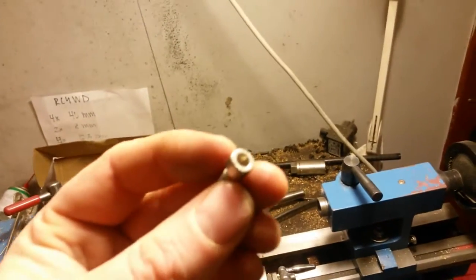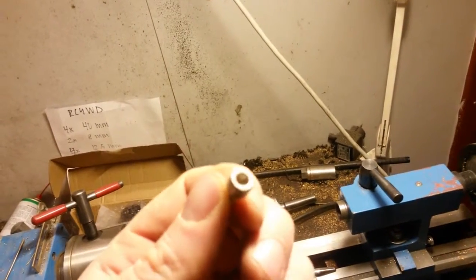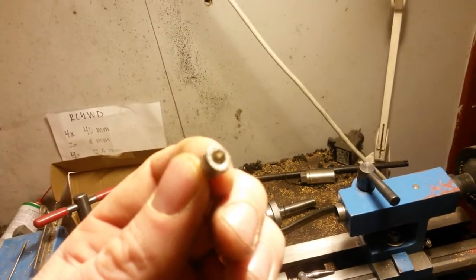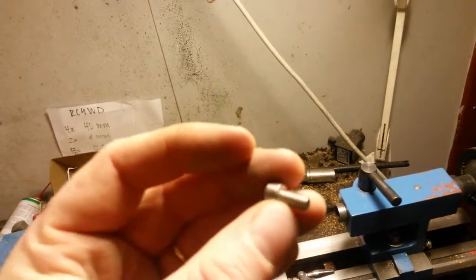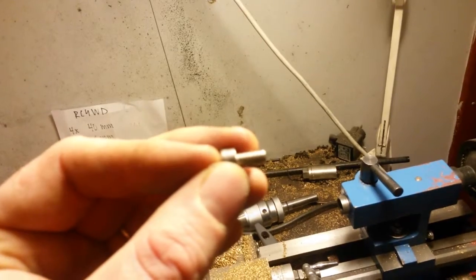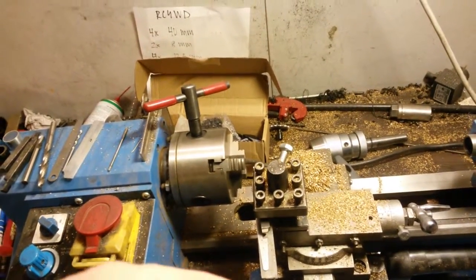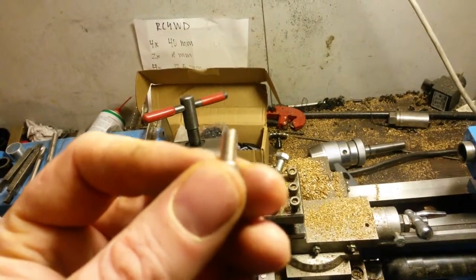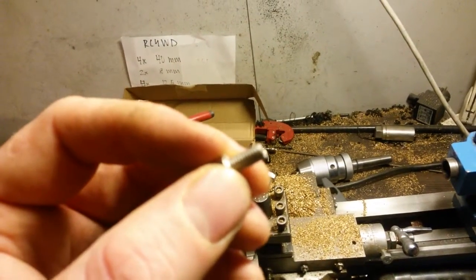I was hoping to find a Torx head screw, but I didn't, but I found these. These are also Allen key screws, but you can see that the Allen key that fits in there is much bigger. I think it's 5mm. But I needed 8mm long screws, and the shortest I could find was 10, so I have to shorten these in my small lathe here. And hopefully I will be able to replace the screws. Let's see how it works out.